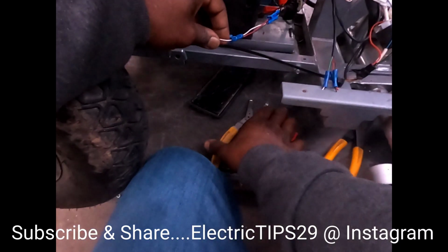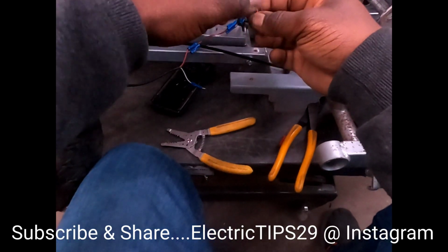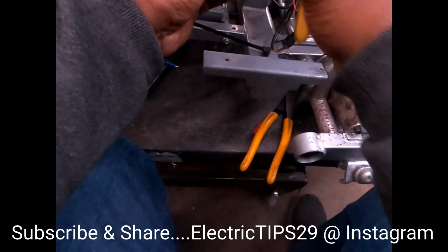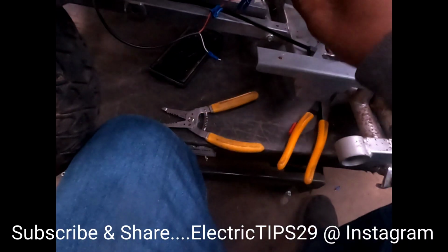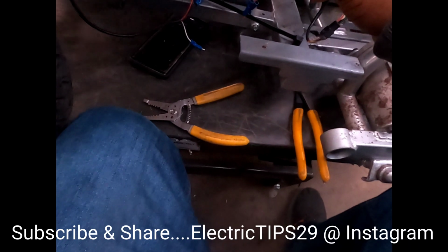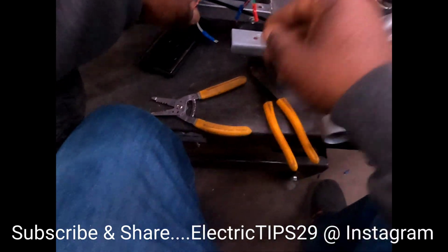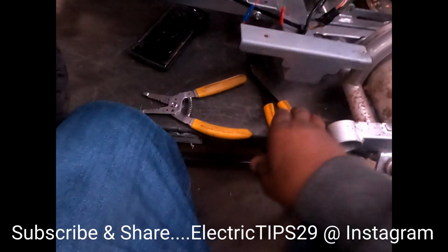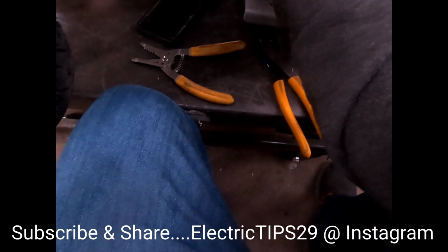So all I need to do is cut this wire right here, which is the signal wire. From this controller, leave everything, cut the signal wire. Now join these signal wires all together so that you've got both controller signal wires tied together. Once the signal wires are tied together and 1 positive and negative is sent to a controller, the throttle will control both of them.